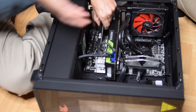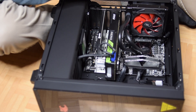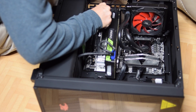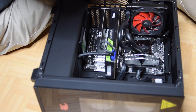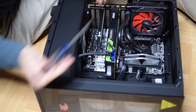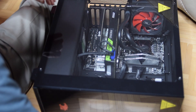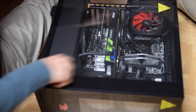I'm going to slide the plastic retention clip forward, and that should be it. We want to make sure it stays seated. You always want to start by hand-tightening, and then you can tighten it with the screwdriver after. Alright, the card's in. Put the top back on — I like to tighten to opposite ends. Fire it up!